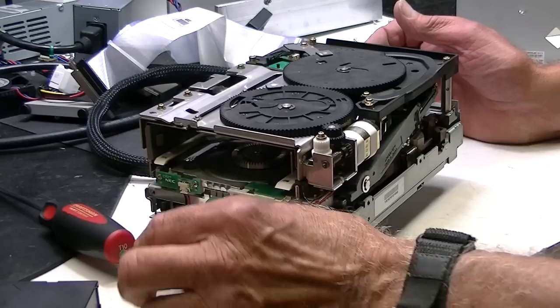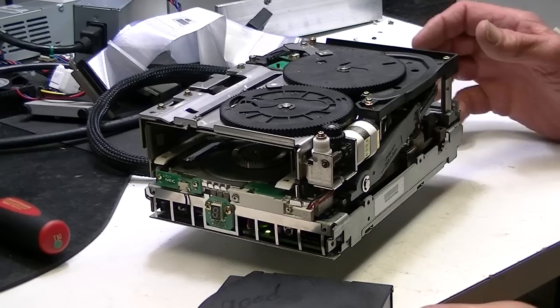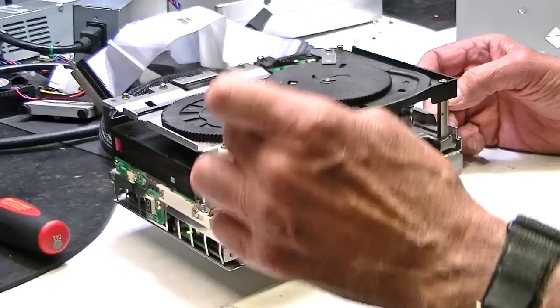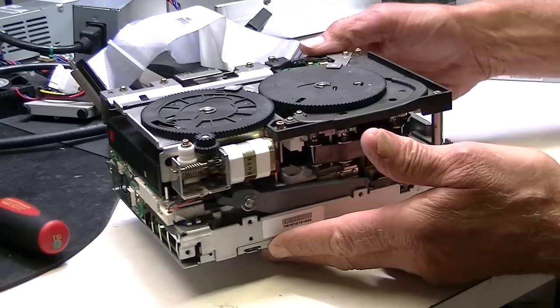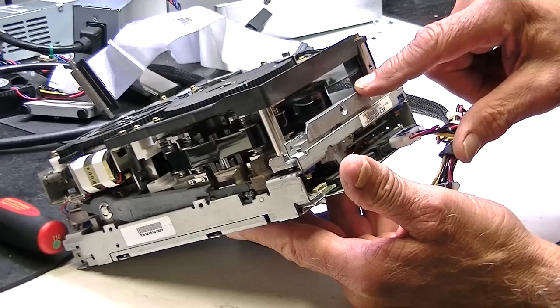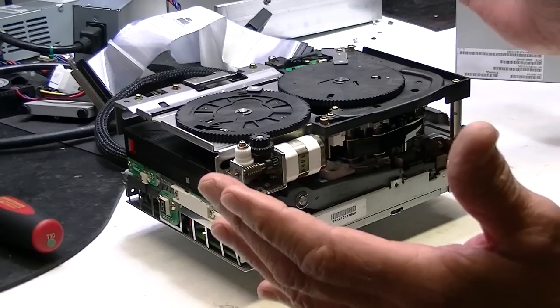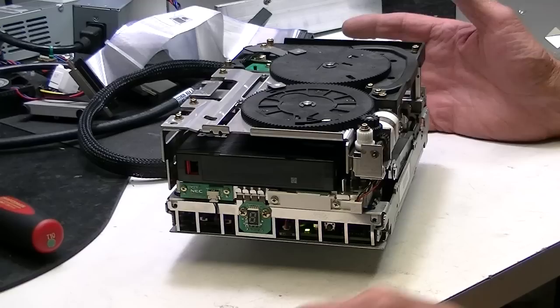To demonstrate the principle of how to remove a stuck tape, it's important that you understand the concept of what happens when you load a tape. This tape is ready to be loaded — we put it in and give it just a little push. Now mechanical things start to happen: this gear turns, it picks up a leader pin, and that leader pin is wrapped up on the take-up spool back here. The tape and the pin are inserted in a slot board. It goes back and forth and loads maybe 20 or 30 times around, finds the beginning of the tape, and says it's ready for data.